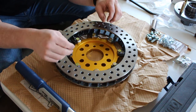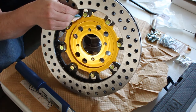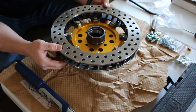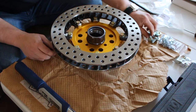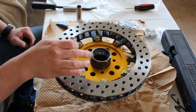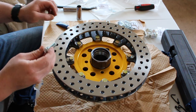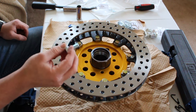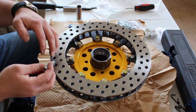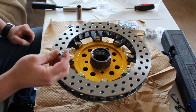Now we're going to install the rotor onto the hub — we'll flip it upside down, put this part on, and do the same thing with the bolts for the hub. These are larger bolts so we're torquing them to 45 foot pounds. They also have a lock washer and we're still applying Loctite as well. We don't want these backing out, especially with aluminum and steel components together — they heat up and cool off at different rates. If we decide to track this we'd need to change this hardware to something we can safety wire so no bolts fall apart on track.